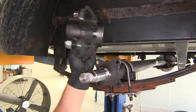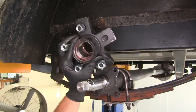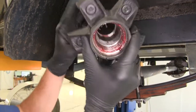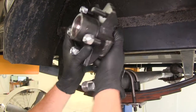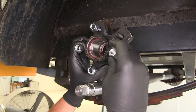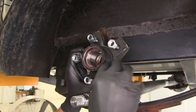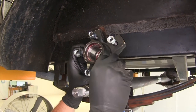Here's a good look at the hub. We've got the cast iron hub, which is going to give us excellent strength and durability. It's going to have the races already installed inside, so our bearings are going to match to that. Of course, there are five studs — these are going to be half-inch in diameter — and you do get brand new lug nuts. These are on here backwards as shipped; you want the cone to face the tire, so keep that in mind.